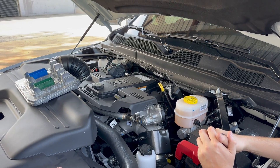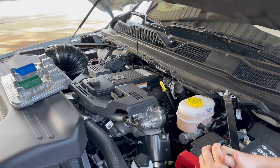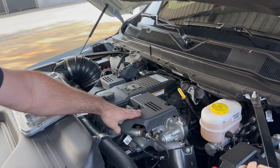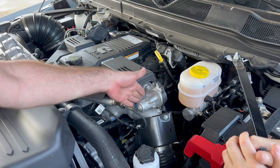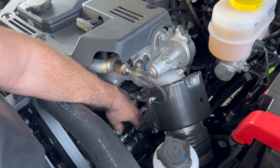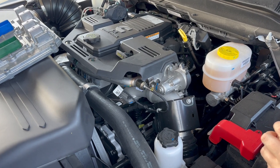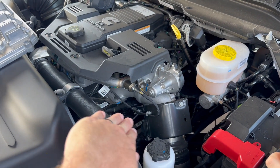We're outside with the truck, ready to do the PCM swap. Basically what we're going to have to do here is remove the cover for the EGR pipe, remove the pipe going to the intake for the EGR, and pull the intake horn back a little bit. There's also the feed line for the CP3 down here that needs to be unhooked, and that will give you access to the connectors for the ECU and all the bolts. So the ECM comes out between the radiator hose and the intake — the intake has to be lifted up and rotated out of the way, and the ECM comes out in this hole right here.